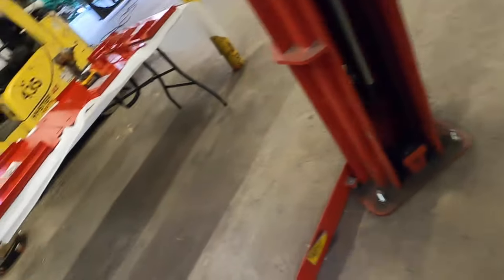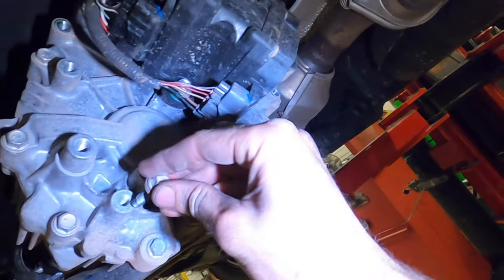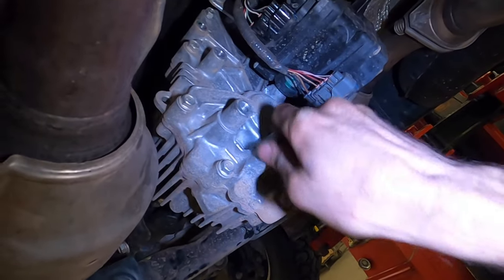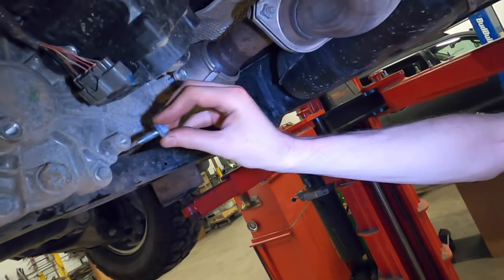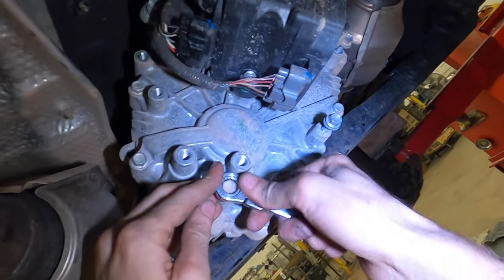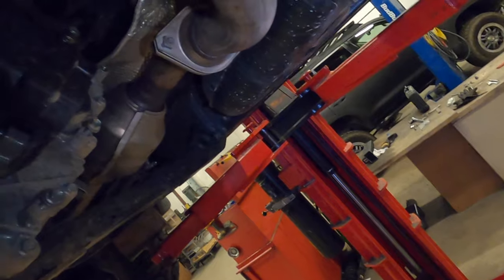And the cage just comes out of the way. Again, this is where we like to put all these back in. Got an anti-seize one? We're big fans of anti-seize because we hate seize, we're anti-seize. And we're not going to torque these down just yet, or at all. Just snug them up. It's cast aluminum. Just a little bit. You don't want to crank down on this stuff.